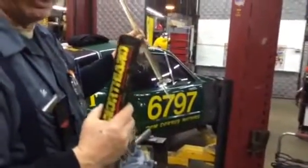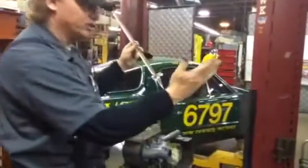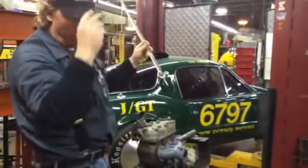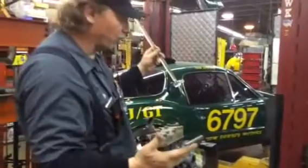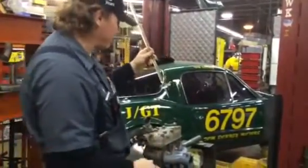I've already put grease into the cylinder walls with the piston at true TDC — top dead center — and I grease it so the solvent doesn't go by. You can use solvent or water or whatever. I don't like water because it adheres poorly and if it gets anywhere it'll go down into your main bearings.